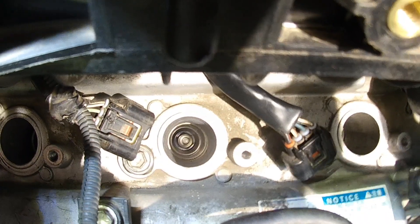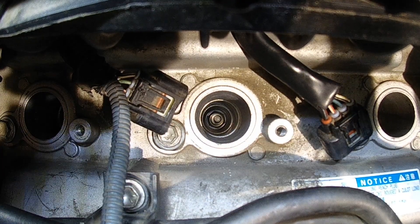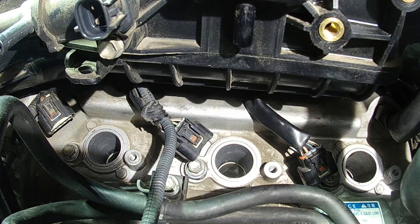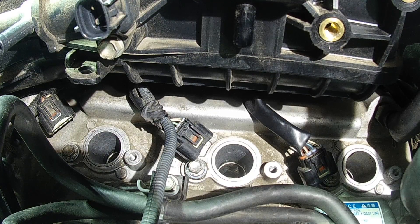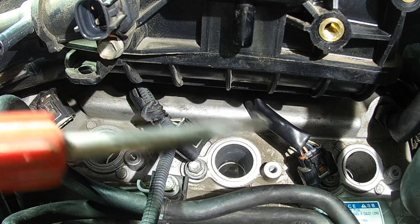Let me see if I can get a shot of this — way down there is your spark plug. Can you see right down there in the center of your screen? That's your spark plug. Now, if you have access to compressed air, this is a good time to hook up your compressor and blow compressed air down there. Because once you take the spark plugs out, you're going to have a straight shot into the top of the cylinder, top of the piston. You don't want any foreign debris — dirt, dust, whatever — to fall down into your engine. Go ahead and shoot air down there before you take out the spark plugs.